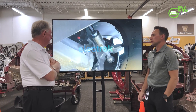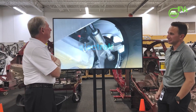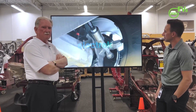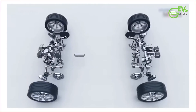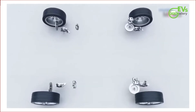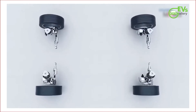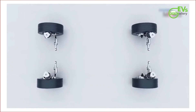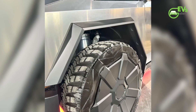The 13-minute-long presentation shows an independent front suspension with aluminum front lower control arms as well as an air suspension strut. The reason for using aluminum at the front is that in a crash, aluminum cracks, allowing the wheels to detach, while steel bends and keeps the wheel in place, which can lead to impact forces being translated into the cabin.